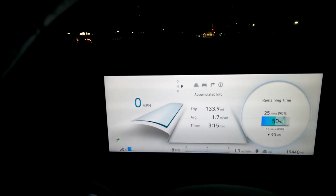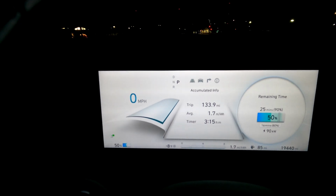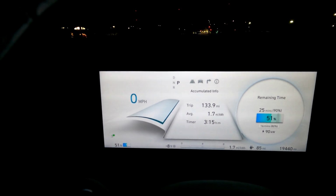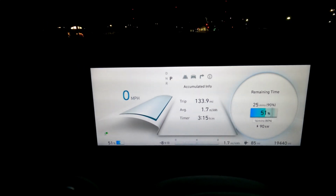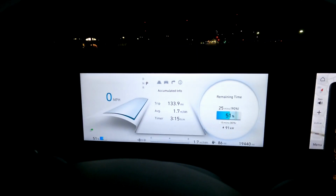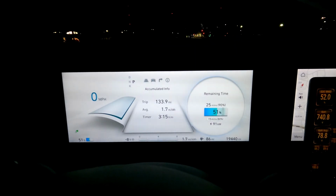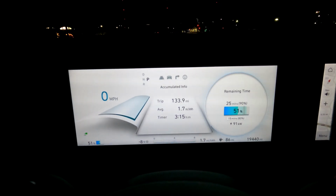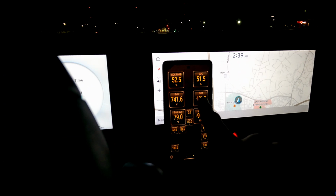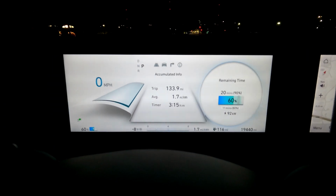At this station, some of the power has been sporadic. People report down to the 40s and 50s on some, but again, this time of year you just don't know whether it's the people being confused about what their car can do or the station itself being derated. But we're obviously getting a gradual extra little bit of power here as we get the battery up to temperature. So this, in our case, is the vehicle limiting this amperage, so not much point in hanging around now.